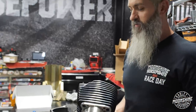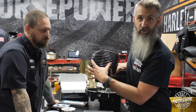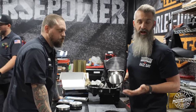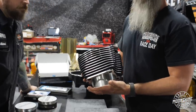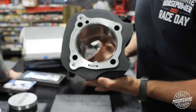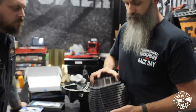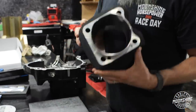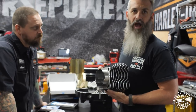We do the cylinder several different ways. We have a pair of CNC cylinders which allows us to make the internal body larger, and when we do our CNC cylinder we're also able to make the fins larger for a little bit more cooling. This right here is your factory Harley cylinder — brand new. When we do our kits, we start with a brand new Harley-Davidson cylinder, bore out the stock sleeve, and put our sleeve in. All the 135s and larger need a case bore to accept the larger spigot, which is the bottom of the sleeve inserted into the lower half of the case.